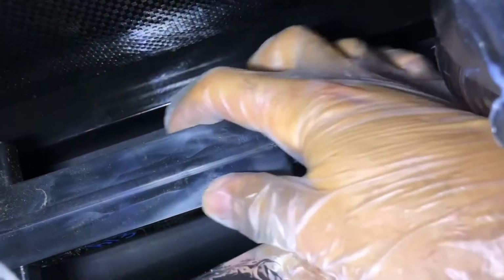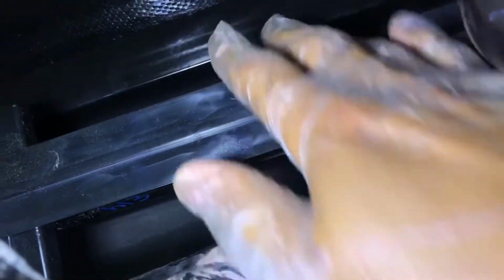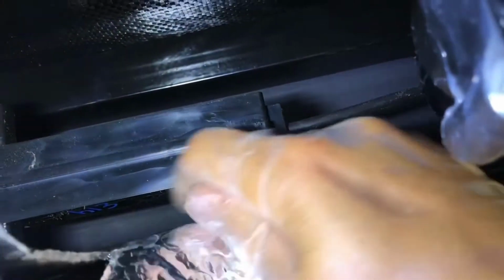It'll be on the top part up here. I felt it earlier. It's back here, right there. This will release that. And then my Allen key is always going to be on the top too. There's some holes in here. I'll have to just drop it in one of these holes and see if my Allen is faced up, so that I can just pull my cable out after that. And so after I do that, then all this should become loose, and then that way I can get this plastic piece off, and then I can start working with my valve.